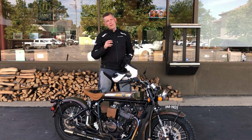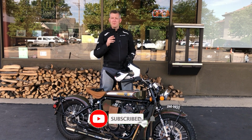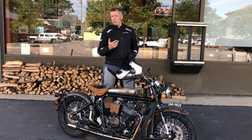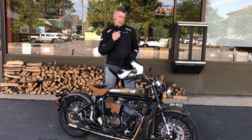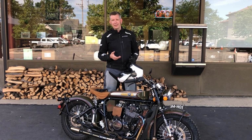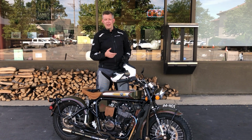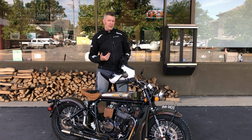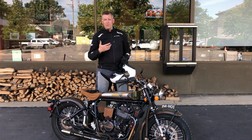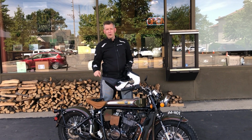All right, so the first step, as we mentioned, in checking your oil level on your Janus 450 is going to be bringing the oil up to operating temperature, which means taking the bike for what we recommend, a 10-mile ride. It is not sufficient or advisable to run the bike for 10 or 12 minutes at idling. It's an air-cooled bike. You can see really elevated exhaust valve temperatures doing that. The engine is designed when it's running to have air flowing over it. Also, putting the engine under load, like you do when you're riding it, is going to make sure that that oil is fully normalized at an operating temperature, which will allow you to correctly read the oil level.